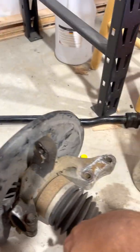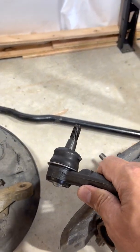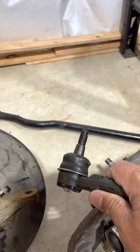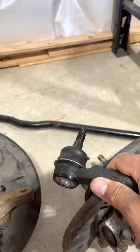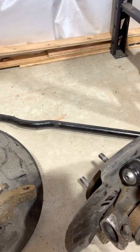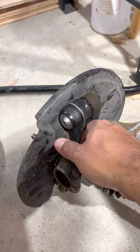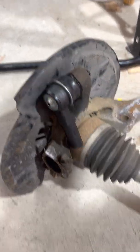There's a 15 WRX bar, which coincidentally I think comes at like 23 millimeters, which is almost an inch, which is bigger than the bar I had on this car before. I had a 22 on it, so that's a 23. So as it is, it's already going to be a stiffer bar than what I had on the car before. So if I can make it work, then that will be fabulous. So yeah, that's where the project sits.